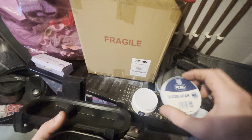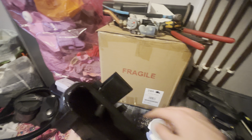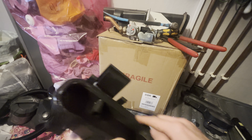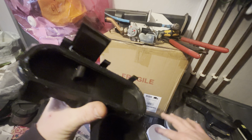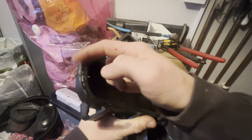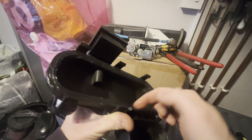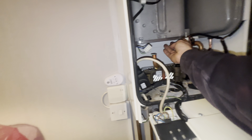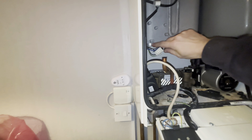So let me show you how to get this new one on. With a new sump, get some silicon grease and I'm just going to put it around here. It won't hurt the washer - it's silicon grease, don't worry. This will just help it go on when you're trying to push it up at the back, which you'll see in a minute. That is the hardest bit - getting this one back on. Also going to put silicon grease around here as well.